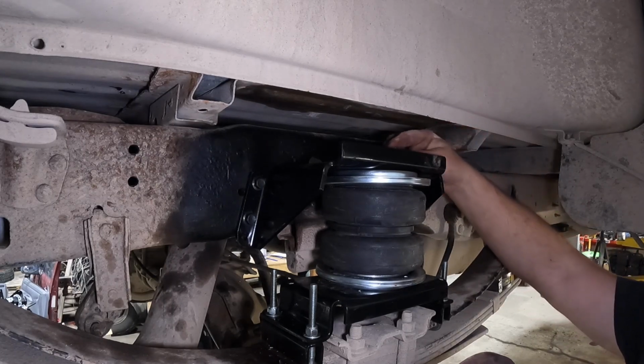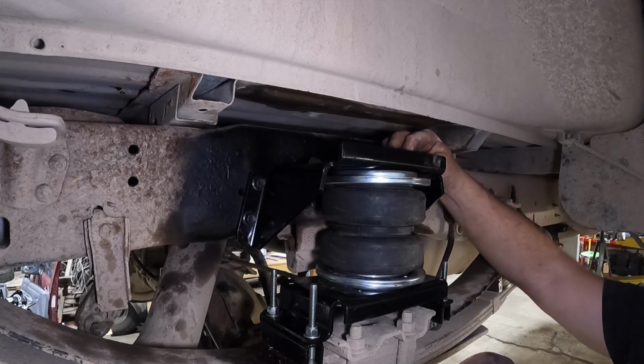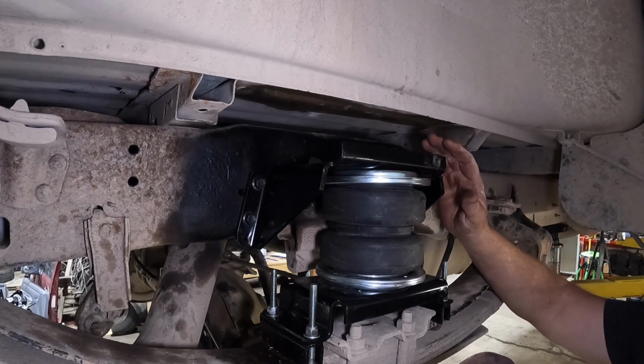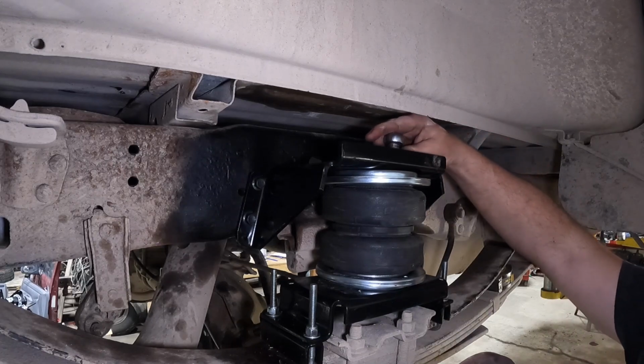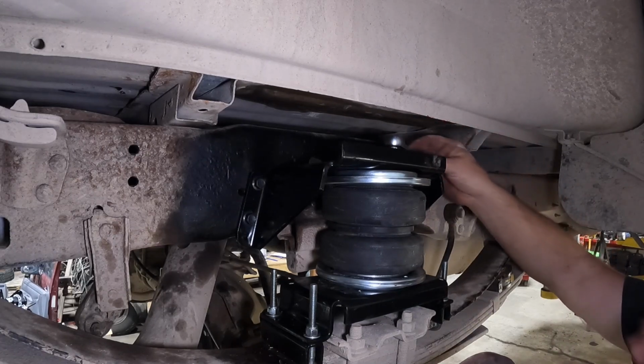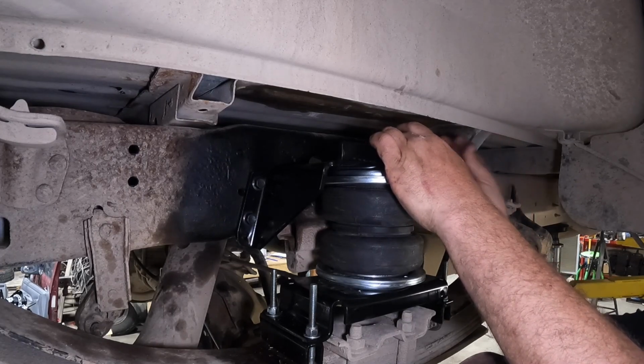One thing you wanna know is that we couldn't find torque specs and we called the company and no one answered the phone. So we're gonna tighten those bolts on top that we showed you earlier, just till the flat washers crush. So I'm guessing it's gonna be between 16 and 25 foot-pounds. And that's what we're gonna kind of go with. You don't wanna over tighten them because they're kind of like a riv nut into the top plate.